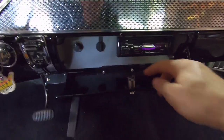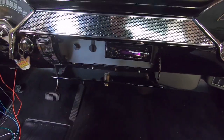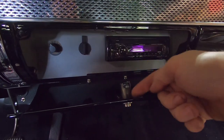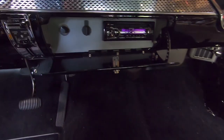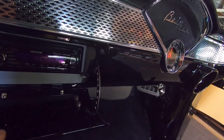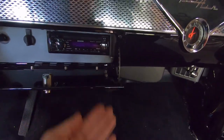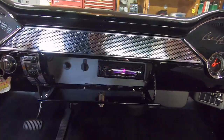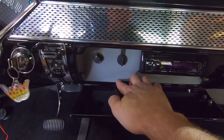The glove box latch bracket is basically a piece of C-channel, and I used some tubing cut to fit in that pocket to make it one solid piece — smoothed it out and painted it, one of those details no one's ever going to notice. I drilled speed holes in my latch bracket — this is basically the stop for the glove box so it doesn't fully extend out. I put 12-point ARPs in everything and had to cut all of those down so they wouldn't put high spots in the glove box door. I have a 12-volt outlet in here and a little Kenwood CD player in here.